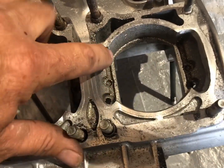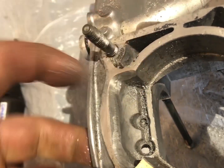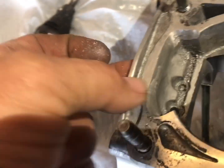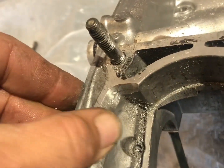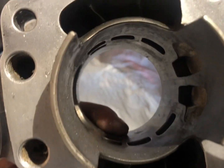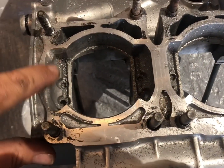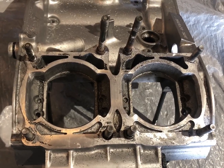There's quite a bit of material on these edges here — enough meat that you can remove and get a nice bevel on them without removing a bunch of material on the face. You don't want to remove material down in here; this is pretty thin — this is your transfers. I'll do these inside two here and this one will be good to go. We'll clean these up a little bit and should be good to go.